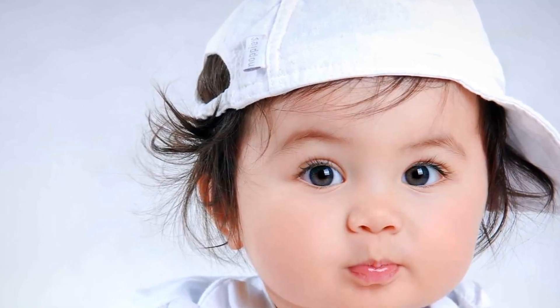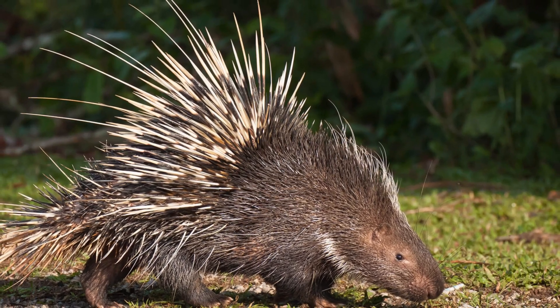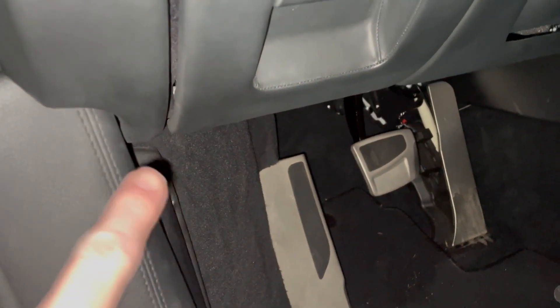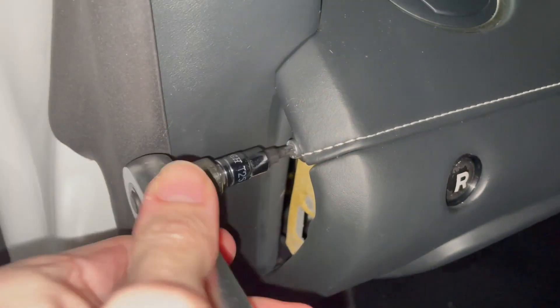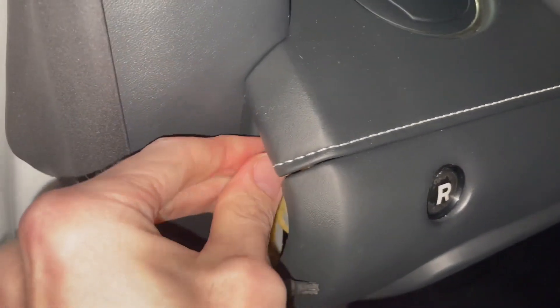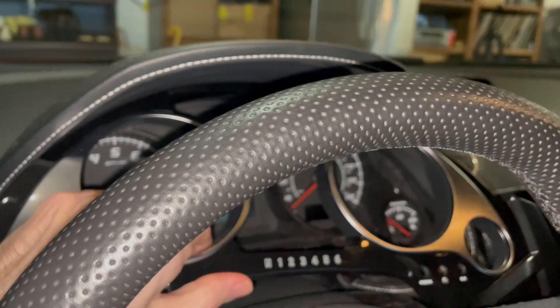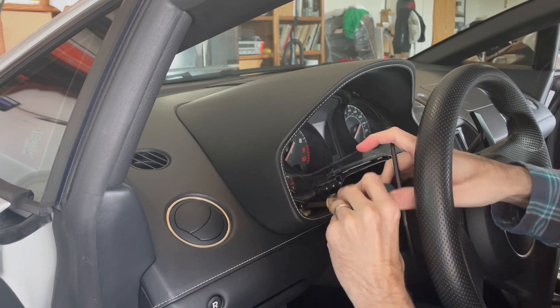If the removal process and button creation for the three center buttons was as smooth as a baby, then I'd equally have to say this reverse button was as rough as an agitated porcupine. I quickly found and removed the two Torx screws underneath the dash. I also discovered that using a wrapped screwdriver like with the center console, I was able to pop out the little triangle piece on the side of the dash, revealing a third smaller Torx screw. But there were still two more screws keeping the entire thing secure.